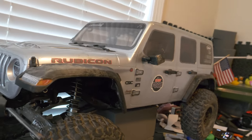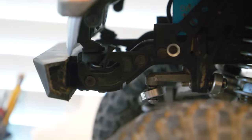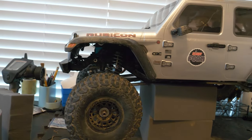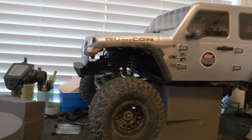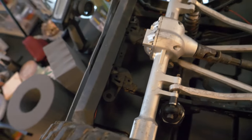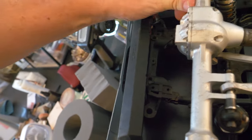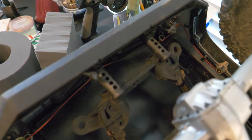One thing you're going to notice is that I've cut this front bumper down quite a bit where you mount up. You can see I've chopped that front rail down quite a bit, and this is what's pushing the body back and gives it a very squatted look right now. We're going to have to figure out how to level it up and lower it down. The back's a little different because I've done so many modifications — I chopped the rear down too. I needed some way to attach the body, so popping the bumper into the slides and attaching the body through the bumper was my best choice. That's how the body stays in back since the rails are chopped — it actually gives me a much cleaner approach angle.